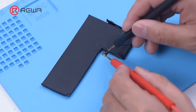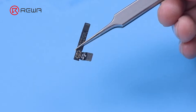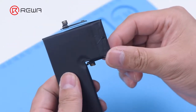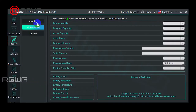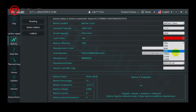Activate the battery with the direct current supply. Because the data of iPhone 11 series can't be directly read, we need a specialized PCB board to read the data. Install the PCB board to the battery, then connect the battery to the programmer. Click Reading, then recalibrate the cycle times and battery efficiency.